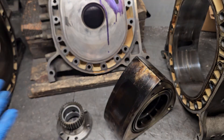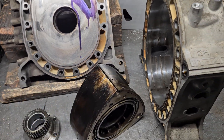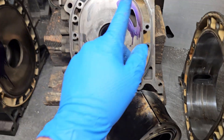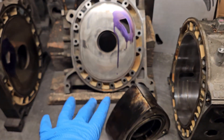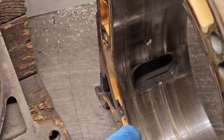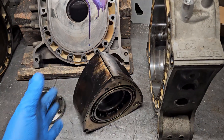As we took it apart, this was more damage than the customer expected. We're like, okay, we've got to replace rotor housings, replace a rotor, potentially balance. We're going to do some bearings, might as well throw a street port on it. It becomes more of an involved build versus a simple rebuild. So just be aware — you blow up some apex seals on a brand new car you just got, it can be costly.